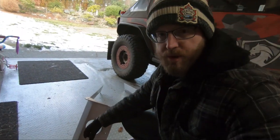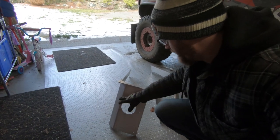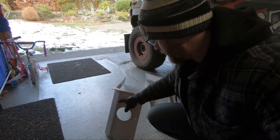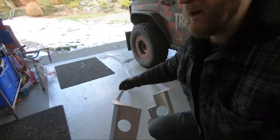The thing to note with doing this is it's going to require some cutting of the body. This hole doesn't line up with your factory taillight hole — your factory hole is something like that — so you end up having to cut out this additional section. You basically mock these up, get everything lined up, get all your nutserts installed, and then mark out where this round section is going to be. When you take them off, you cut out your body, hit it with some primer, pop these guys on, and then you'll have space for those round taillights.